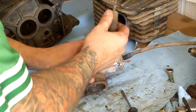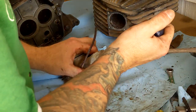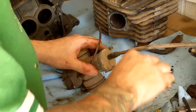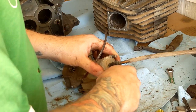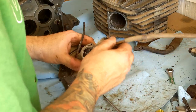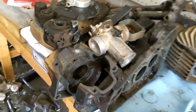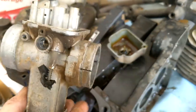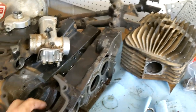Start by getting some of this stuff off. Yeah, a nice little wing nut there. Throttle body is just a little bit warped. Okay, I lost some power with my camera, so I didn't get the carb apart on film, but I think we've all done enough carbs. I was mistaken about that tickler. I guess that was part of the assembly. I'm not 100% sure how to get this out yet, but it's all there. Now I'll take it to my buddy for vapor blasting.